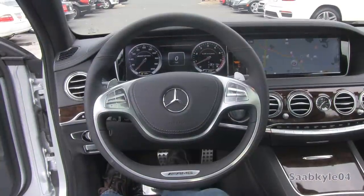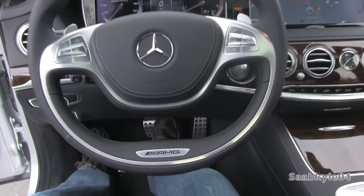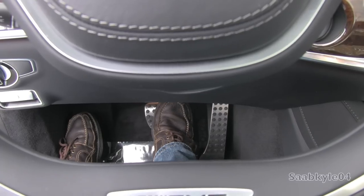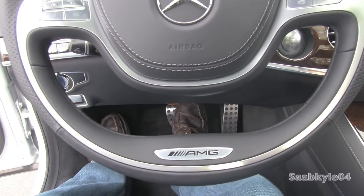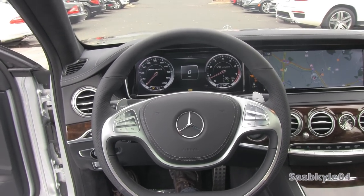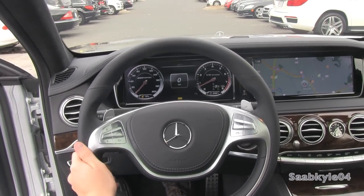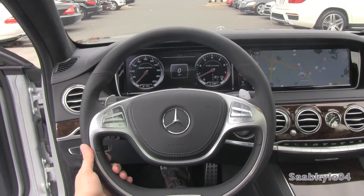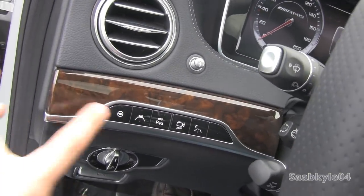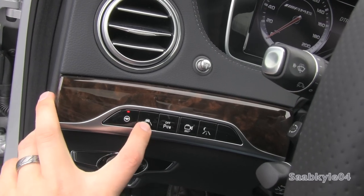Among the many safety features we'll highlight in the video, the vehicle also comes standard with steering assist as well as lane departure warning that allows the new S-Class to partially drive itself at certain speeds. There's also an adaptive braking system that helps counter crosswind resistance, balance wheel load, and damping, not to mention a hold function that, if turned on, will keep the car planted at a stop without your foot on the brake. During wet weather, the brakes automatically work to dry the rotors in case of emergency braking.